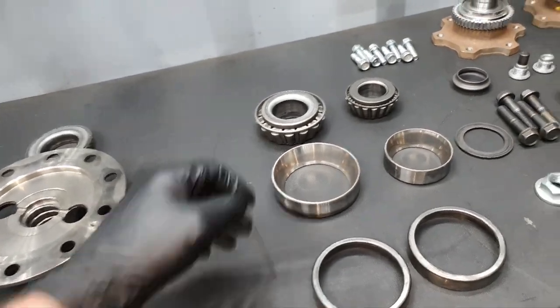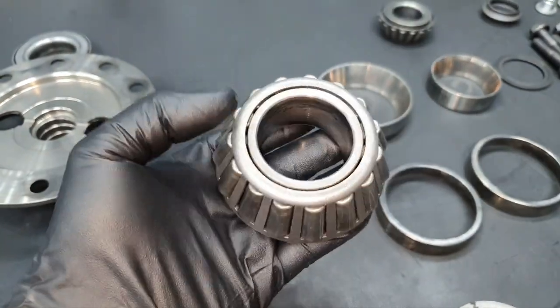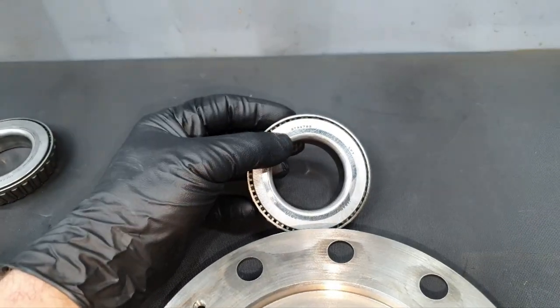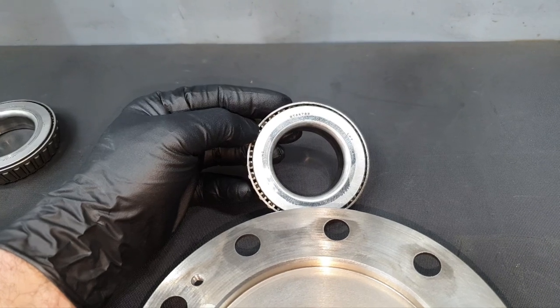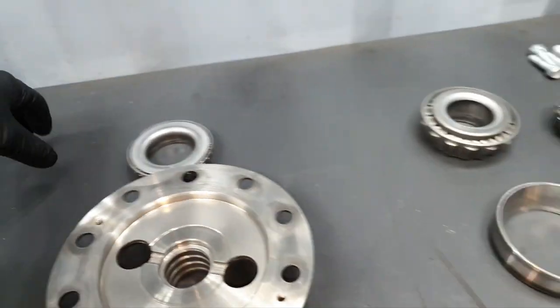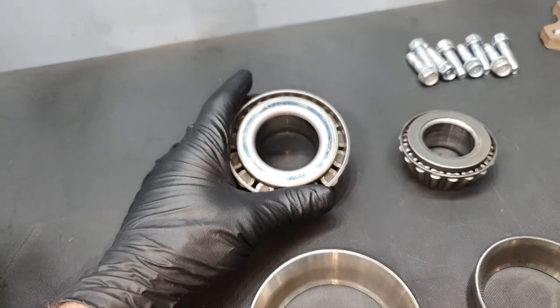Should we see now the gears, the bearings? The bearings, yeah, I'm gonna replace all these bearings. Okay, left and right on the carrier, it's the same number. It's a Koyo PTA 4785. Yeah, Koyo Japan, nice, not bad. And this one is NSK.